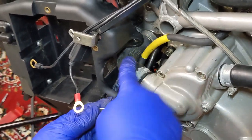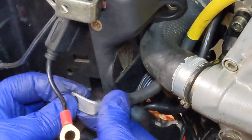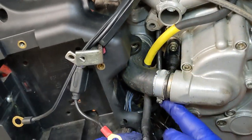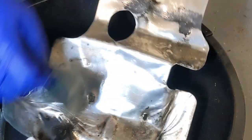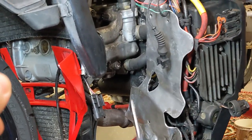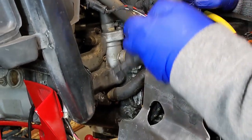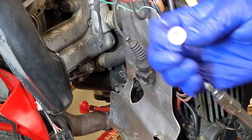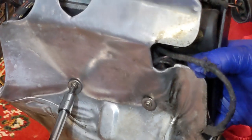But as you can see here, I'm coming from cylinder two, out and across the water pump and then down, rather than trying to pass it up through the chassis, which is just proving to be silly. So here it is, just meeting up with its counterpart. I'm going to pop it into the battery box together, but you've got to be really careful — it's got to go underneath this coolant pipe. There are two coolant pipes here, so it's got to come down here and between them. When the battery box sits, this terminal will be straight, but if you don't route it properly, it will be off at an angle. So it's coming down here, underneath this cooling pipe only, and coming in between the two cooling pipes. So we're just refitting the heat shield now — it doesn't hurt to clean it up. I'm adding larger washers to the screws that hold the heat shield on because of the problem we found earlier. It's worth just taking your time to line everything up and make sure you're happy with it, and the job is good.